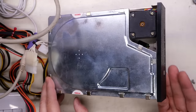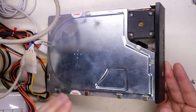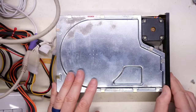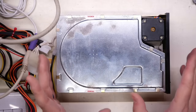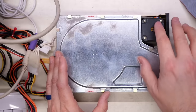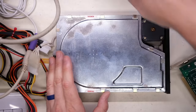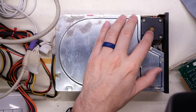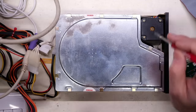Is the light flashing on the front? No. Let's just power it off and on really quickly. Sometimes you might get a flashing error code. It could well be that this hard drive is dumb — like it doesn't do anything at all. It's like a floppy drive. It just spins up the spindle. There's a tachometer just to maintain the 3,600 RPM that these typically run at, and that's it. It needs the controller plugged into it to actually do anything. But I'm not happy with the fact that the stepper definitely does not appear to be moving at all.